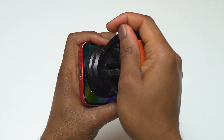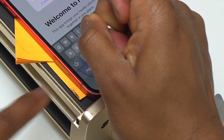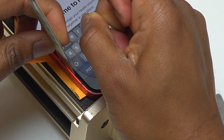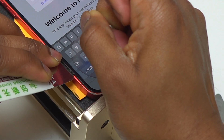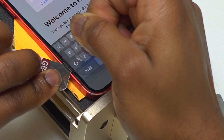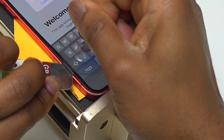Since the screen on this device is broken, I tried to use a suction cup to pull the screen slightly and create an opening between the screen and the body of the device, but it wasn't working. So I had to hold the device in place and use a smaller suction cup to pry one side only, then insert my tool into that area.